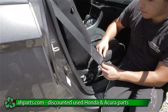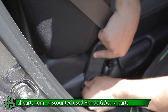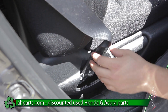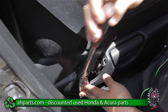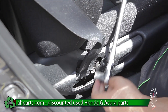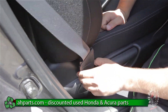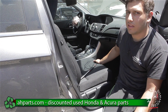The last thing we're going to do is go ahead and put the seat belt back in. We're going to thread it with our hands first, then go ahead and tighten it — make sure that's on tight. After that, we put the plastic piece back on; it just slides in the same way it came out. And there you have it — everything works fine, you just replaced your seat, everything looks nice. Thanks for watching.